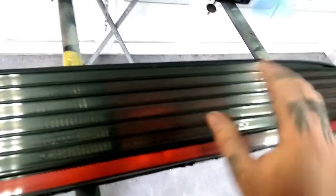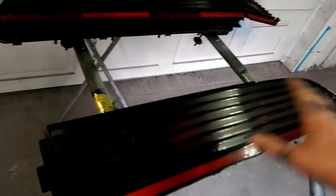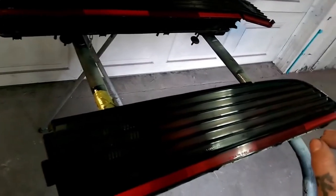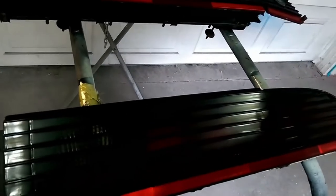Then you can take some alcohol and water — we haven't cleaned these yet, but you can clean them with alcohol and water. After you get your parts cleaned, the next step is to get some good quality adhesion promoter to go on this plastic.